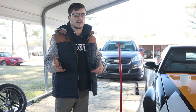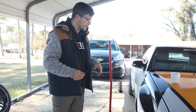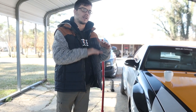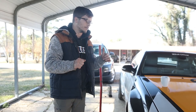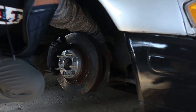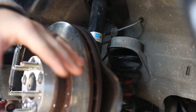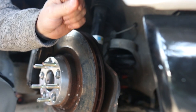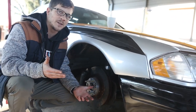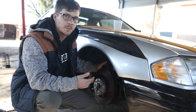One of the biggest concerns about cutting springs that I've found on the internet is that they're gonna fall out if your spring unloads or if your suspension unloads. So if you do decide to cut them, at your own discretion, you gotta make sure that when the suspension is unloaded all the way, the spring doesn't move around. If you look at ours right here, you can see this side is unloaded and the spring is solid. But one of the reasons we're gonna make them longer is because when you lift the other side off the ground and the sway bar unloads all the way, you can actually move it around slightly. So if we were to ever jump the car, I guess, the spring could potentially come out, maybe, I don't know. Either way, we're gonna avoid all of that by putting in a longer spring, so we don't have to worry about the spring ever unloading.